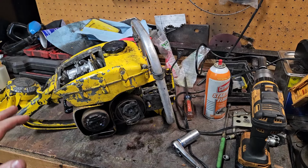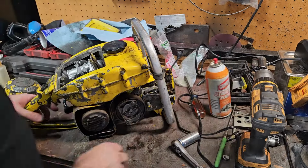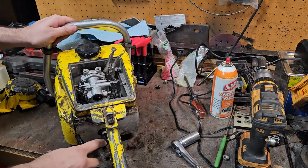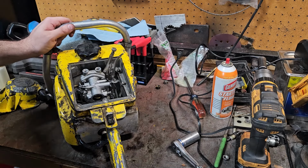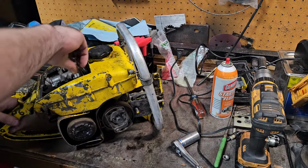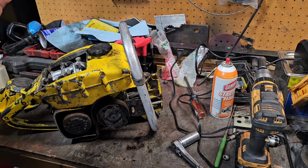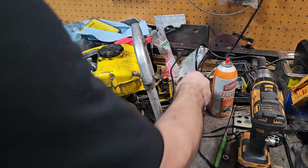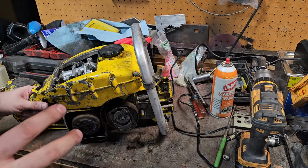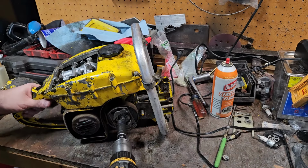Okay, so I've had worse spark leaks than this before and it has still run, but I've seen it physically arc on my D44, physically arc out and go to places it shouldn't. So I don't know at this point. I couldn't tell you. We'll open up the fuel and we'll just see what it does. If it doesn't, then it's a potential coil issue at this point. We've got hot spark, hits by hand, but when trying to run under resistance, like I said, it's going to try to do whatever it wants.